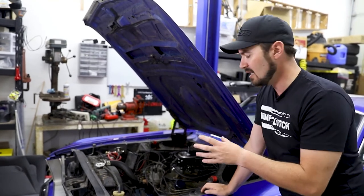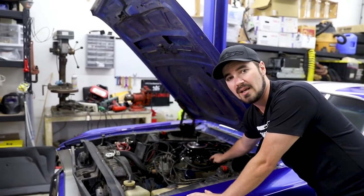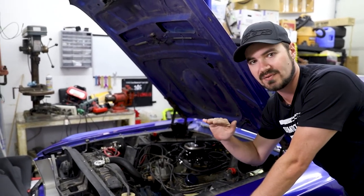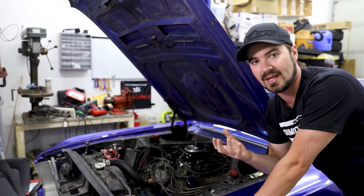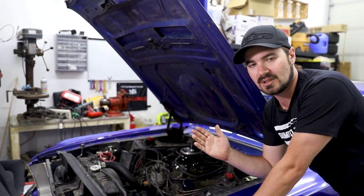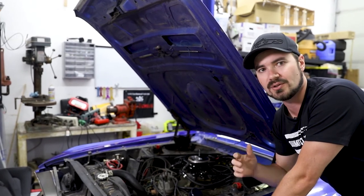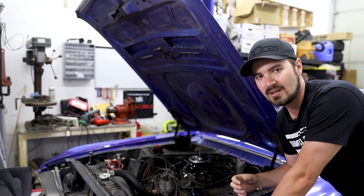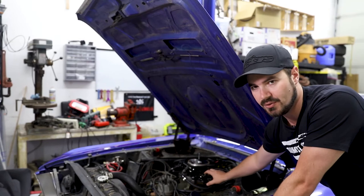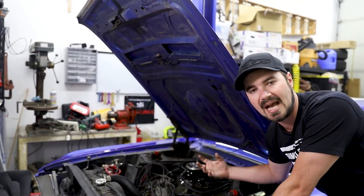To compensate for that, I added a spring back to the existing plate — originally for the kickdown linkage for the automatic transmission — that allows a constant amount of tension applied to the unit greater than that initial break loose. That makes it much more predictable and smooth when you initially idle off the line at low RPM and low throttle, as well as giving the pedal a heavier feel. So if you're having a similar problem, it's probably the need for an additional spring to add some load to the unit.